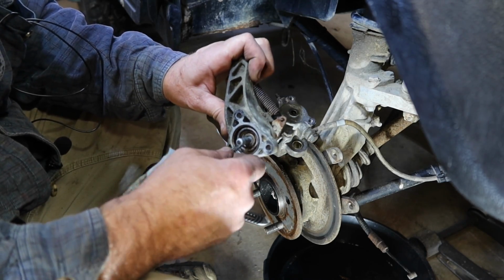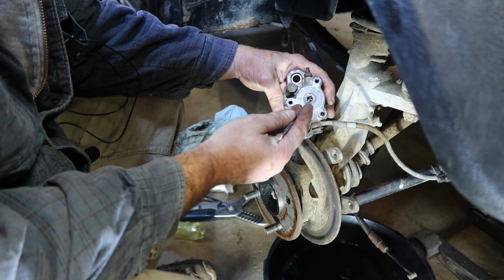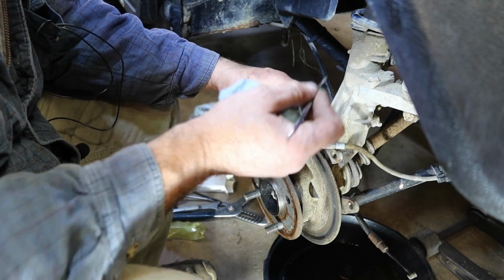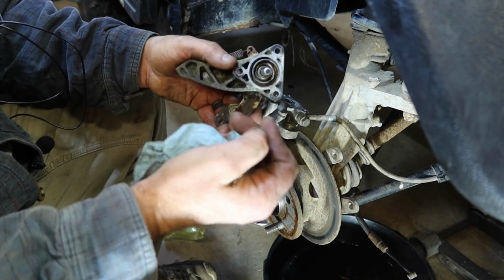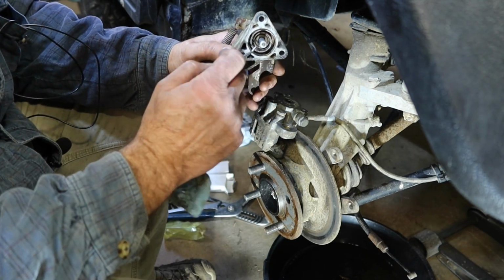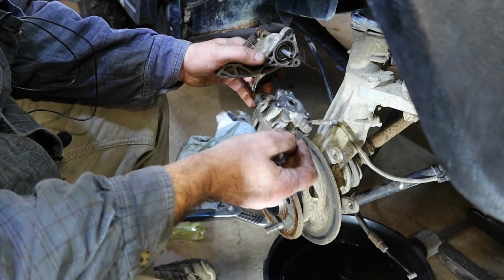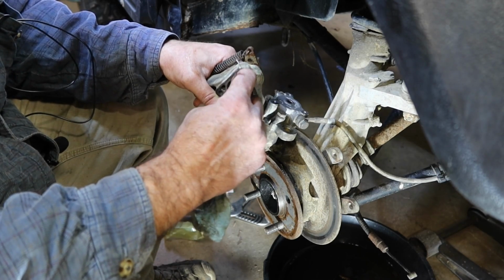There's some dirt and whatnot inside there. But when you look inside the caliper itself, there's the backside of what appears to be a piston in there. And there is an O-ring right here on this lip. I would guess that since this whole side here is mechanical, and the only thing that's occurring is that this is sliding in and out of that O-ring, I tend to think that this O-ring here is potentially what's failed and allowing fluid to come back, because I was also extremely low on brake fluid when I first got it too, which is why the pedal went to the floor.